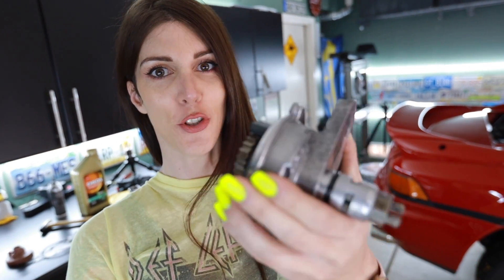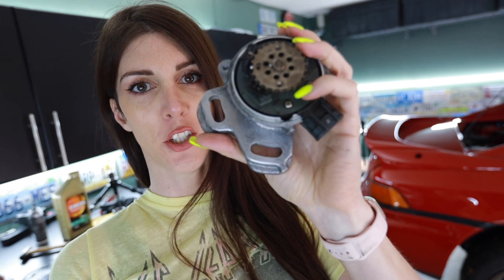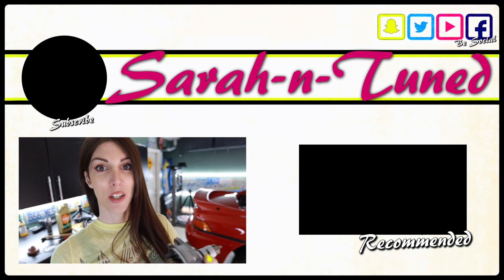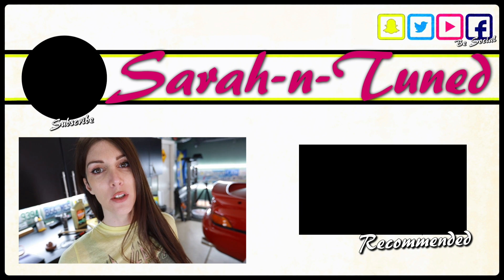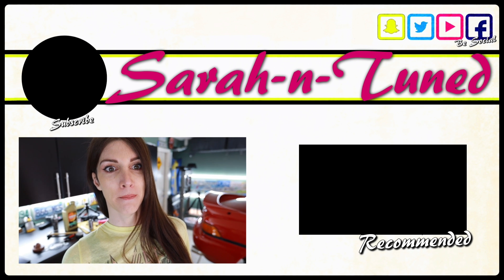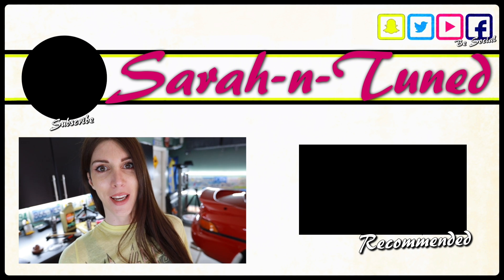That's perfect — yeah buddy! Ta-da! And there you go — rebuilt distributor. Now there's one last thing: these four screws allow you to position this plate that will change the distance from the magnetic tips to this actual gear. You can use an oscilloscope and touch one of the contacts to measure and make sure it's functioning properly, or you can just kind of eyeball it like I'm going to and hope for the best. Anyway, I hope you guys enjoyed this video. The next video the fuel tank will go in, and maybe I'll start it — I should be able to. Okay, bye.